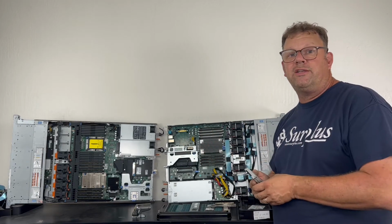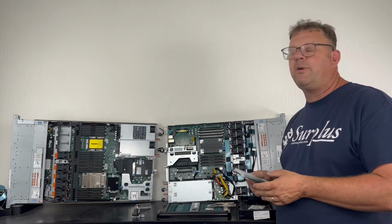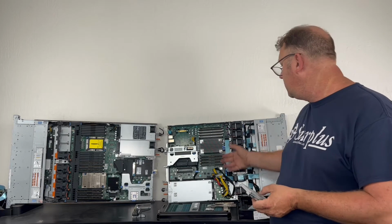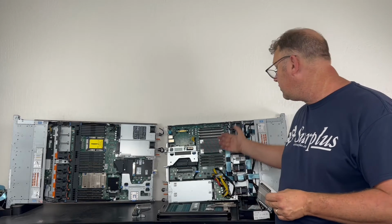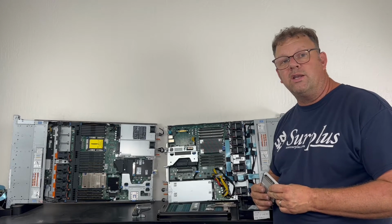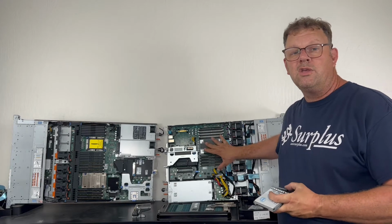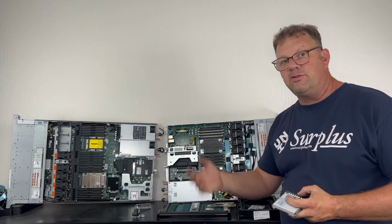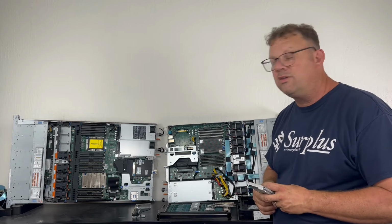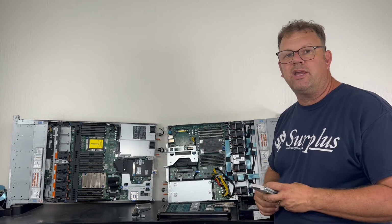If the drives are at 8 terabytes each, and they're so fast that you don't need RAID, you get 80 terabytes into this one particular machine. Fill it up with 64 gig DIMMs, or 128s even, you're already at 2 terabytes running here in this one machine to this one CPU with 64 cores. So you're getting all this package with one CPU, 200 watts, at half the power as you would get from an Intel machine. And that's why people are going to AMD EPYC.